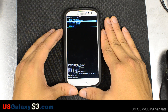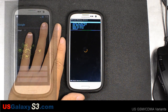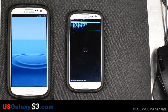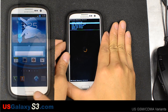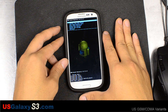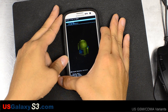I also have a stock restore on my internal SD — that's the stock version with nothing on it. There was a notice on the thread that if you have strange problems or get stuck at the Samsung screen, flash 7.1.12 first and then flash 7.4.12 with no wipe. We did have some strange behavior — a lot of missing text. So we downloaded the 7.1.12. We're going to wipe and do a factory reset. We are installing a completely new ROM, so you should probably do that. If you're upgrading within the same ROM, you might be able to get away without a wipe. Now we're going to flash — install zip from SD card — the 7.1.12 zip.